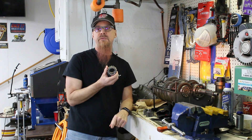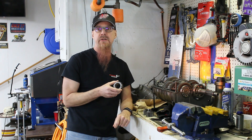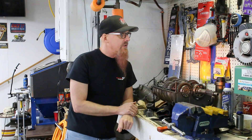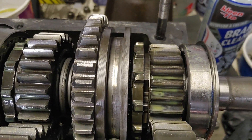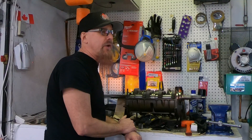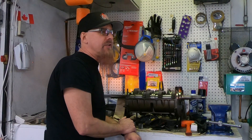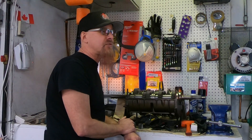Four weeks became four months but I finally got my replacement gear from Liberty so I can get the Doug Nash transmission and the Mustang back down to just one neutral gear again. While I was waiting I had a look around inside the transmission and saw that the lugs on fifth gear were wearing pretty thin. Mine have worn down beyond repair and the slider is wearing out too. So I decided to send my spare fifth gear out to Liberty's and have it converted to a face-tooth engagement system, and that's where this video comes in.